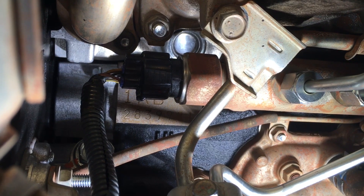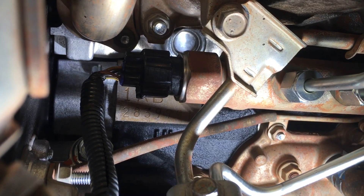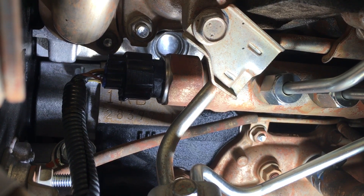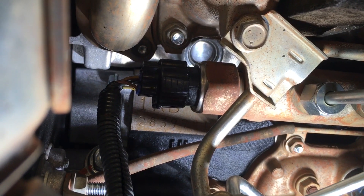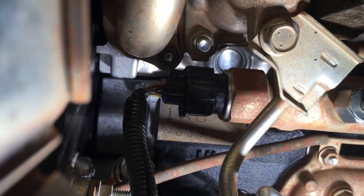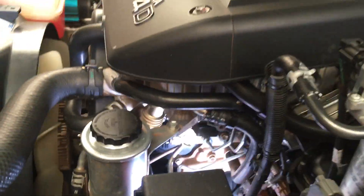You can't just put pressure to one side because you'll cock it up — it needs to be done evenly. When you've got ones that are really tight you just need that little levering effect. What I do is on and off the screwdriver, gently, probably five times or so, and then you'll start to see that dirty line appear underneath where you couldn't clean it. Once I see a millimeter or two of dirt, I release the clip, put the screwdriver away, grab the plug and continue to wiggle and pull until it slips off.